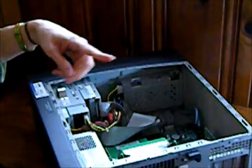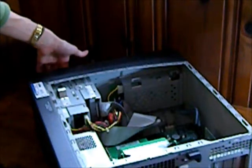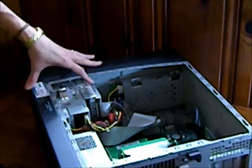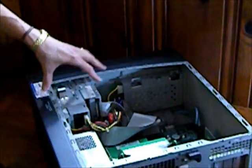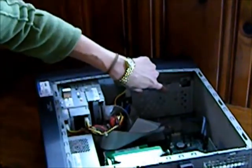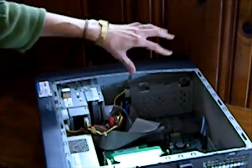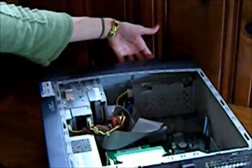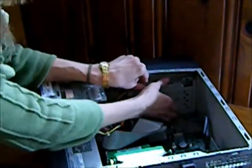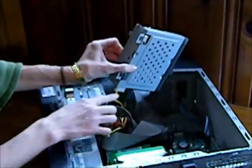Now you want to look around and locate a hard drive. Even if you've never seen one before, you're going to be able to find it, because you remember where your drives were for your floppy disks, your CDs, or your DVDs — those are all sitting up here. What you're looking for is something roughly squarish, and it might be inside a little case like this. I've located this one here. It doesn't actually have any connection to the outside of the computer, but I've found that it's actually screwed in with a couple of screws, and then this case will pop out, and you can see that it's still connected with some wires.